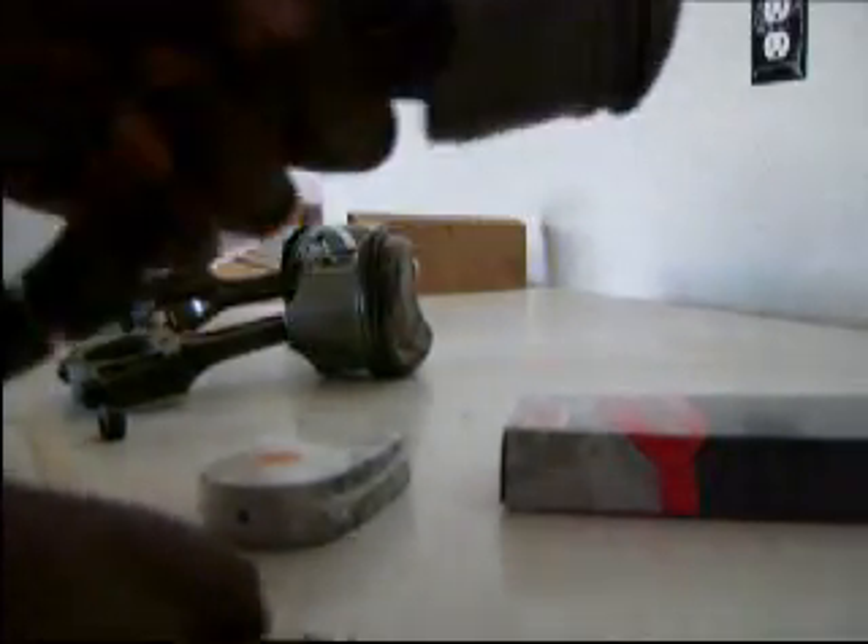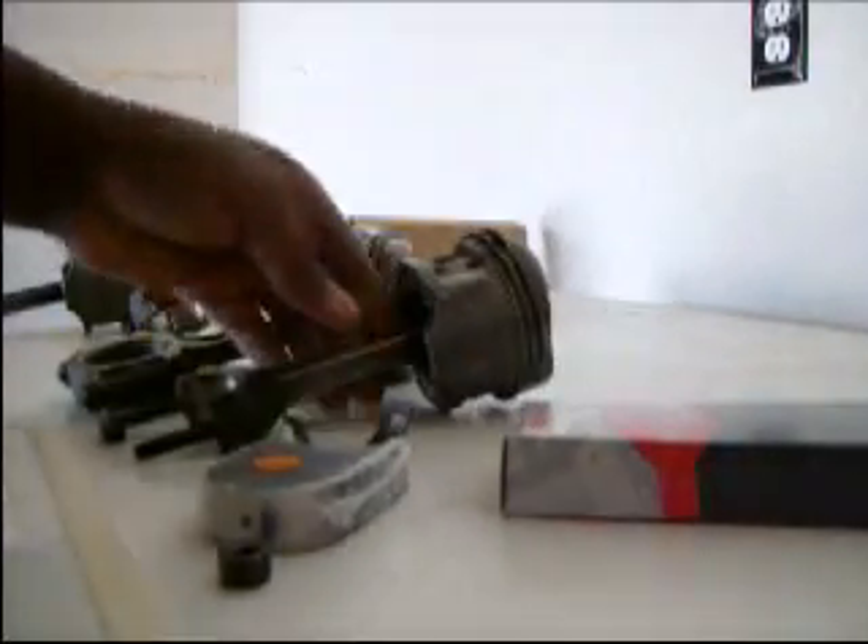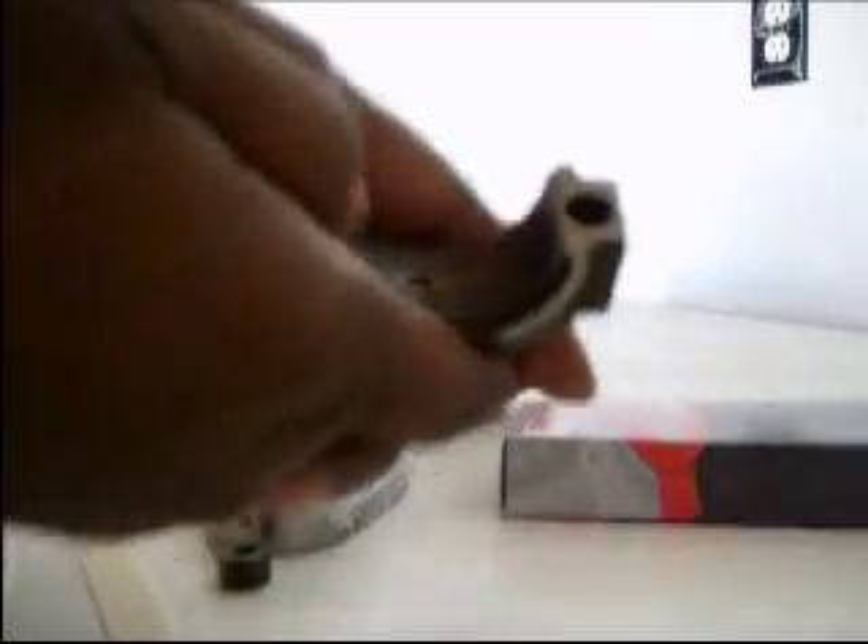So we're back. In short, to install your connecting rods — this is what we're showing in this particular video today. Grab your connecting rods; your pistons already have rings on there, they're already clocked. Take off your nuts off the bottom and pull it off, that simple. You have to remove the bearing — the top half is kind of hard to get out. If you can just catch an edge, your fingernail pops it right out. Do the same to the bottom side. Then you have to clean that surface. Hold on, let me go get a tissue because my nose and sinuses are really messing with me right now.